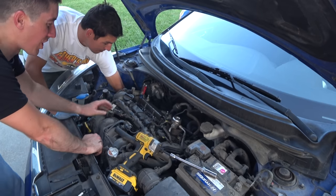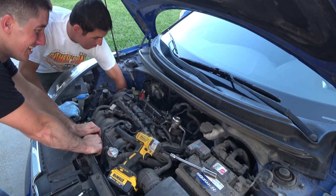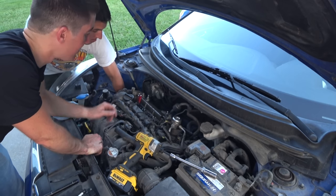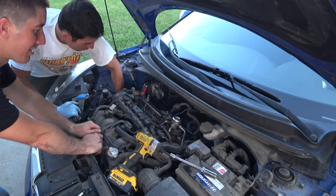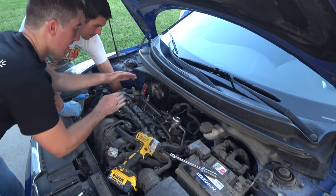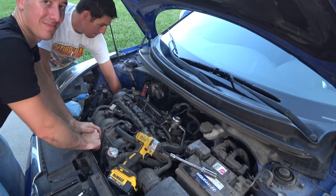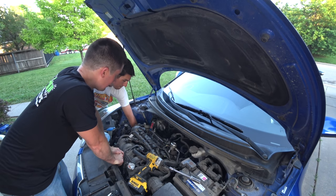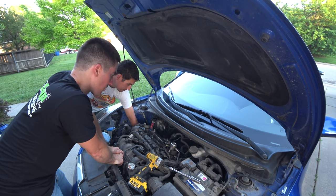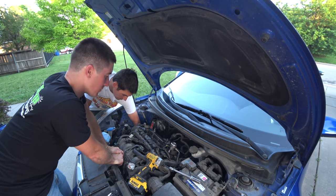All right, let's see. This screwdriver is now the representation of our piston. So you can get it, there's BDC probably, really close to BDC. Coming back up, coming back up, coming back up. And there's TDC and over, and now... Yep. She's dead. Dead, dead. We could spend a few thousand dollars fixing this engine, or we could put a brand new one in for a few hundred.